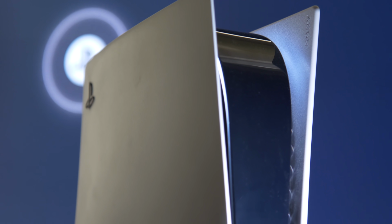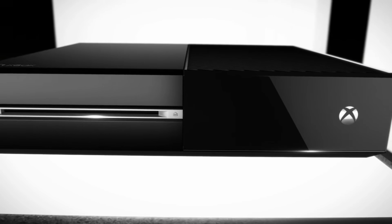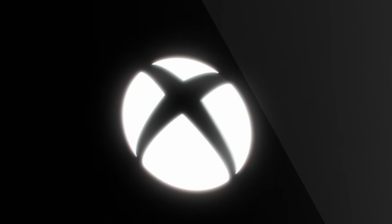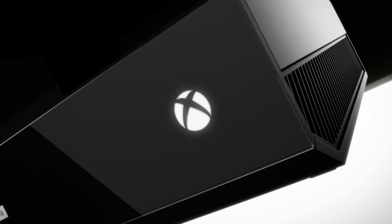There are perfectly valid reasons to pare back what may be over-engineered consoles, or to course correct just a touch because, put simply, launch hardware sees all console components designed in parallel, not one after the other, not in series. The cooler will be engineered without access to final production silicon. With Xbox One here, the cooler was over-engineered to the point where Microsoft increased CPU core clocks by 9.4% and GPU clock by 6.8%, a process that only happened once the Xbox team realized that they had the cooling overhead